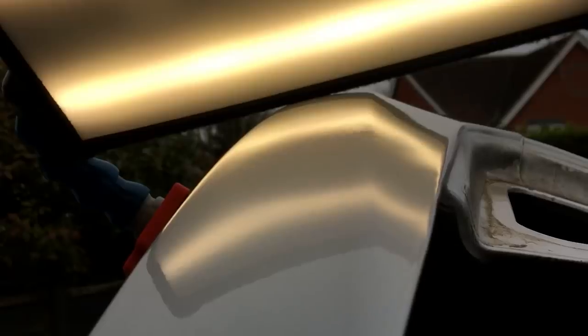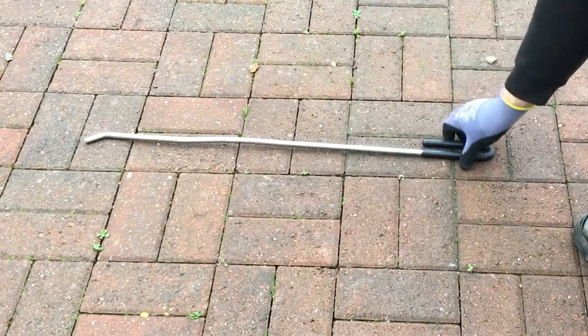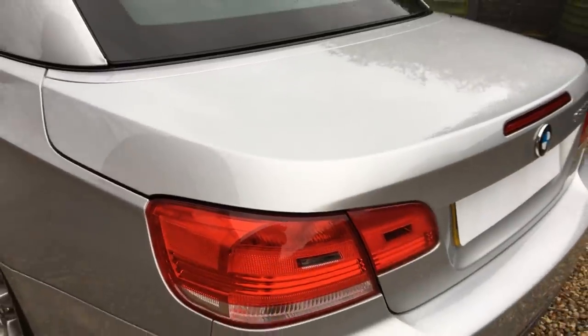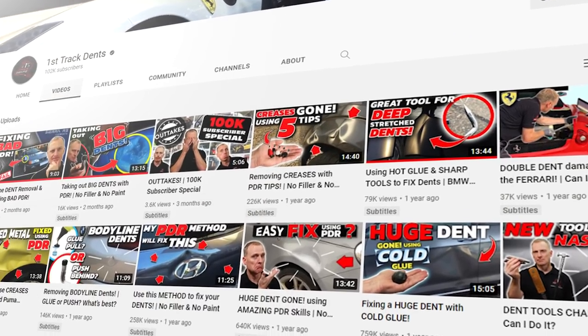Well there you go — not a super difficult dent to remove, although as always with these kinds of dents you have to make sure you attack the right sections in the right order. As this panel had been painted before I wasn't able to use any glue pulling, but seeing as I had really good access behind the dent it didn't matter — I was able to get a good variety of bars behind to carefully push the damage out. Metallic silver can always be a difficult color to repair, especially when pushing out creases, as the paint finish can tend to bruise, so I was extra careful — and luckily no bruising occurred. Everything turned out really well and the customer was extremely pleased. If you like the video, a thumbs up would be great, and if you're not already subscribed, hit the subscribe button and click the bell icon. Thanks for watching and I'll see you in the next video.